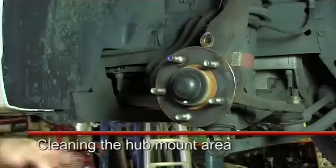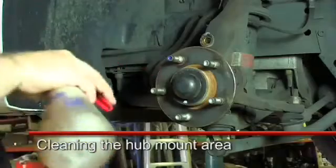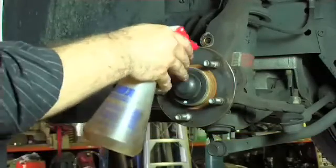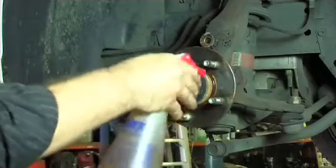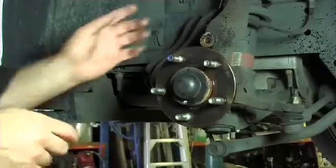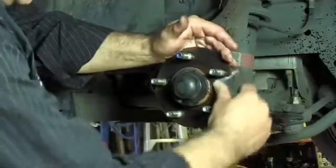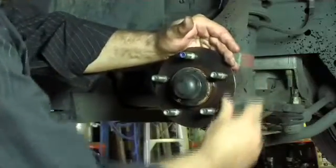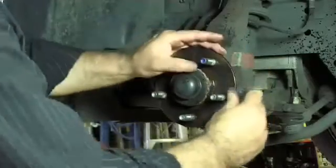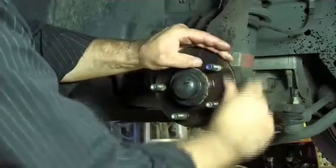What we're going to do is use some coarse emery paper to get the bulk of the rust scale off. But first of all, we use a WD-40 or an inox material to just spray on there to lubricate while we clean. Just give that a liberal coat. Be careful not to get it onto the pads or anything like that. Then we just basically work our way around and remove as much of the rust scale as we can in bulk.